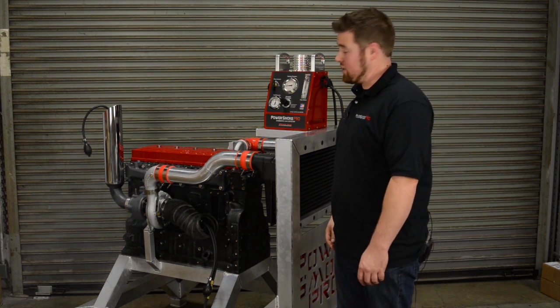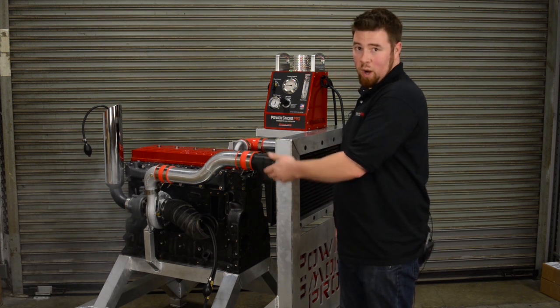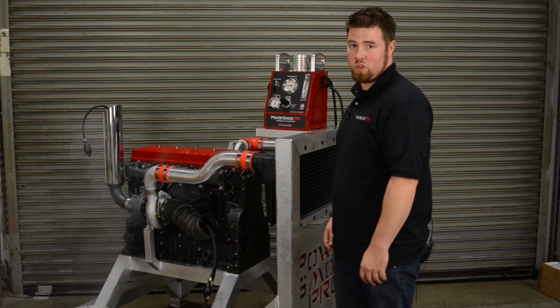We've already begun our test and as you can clearly see, we're seeing visible signs of smoke around the turbo housing and an exhaust clamp that was probably installed without a gasket — things you simply couldn't find with a low pressure standard smoke machine.